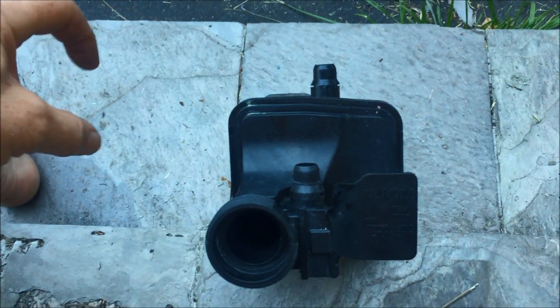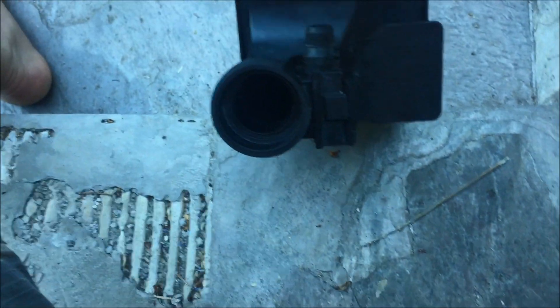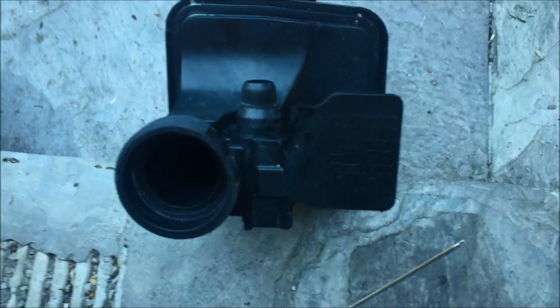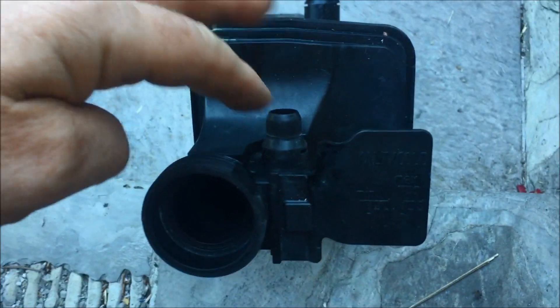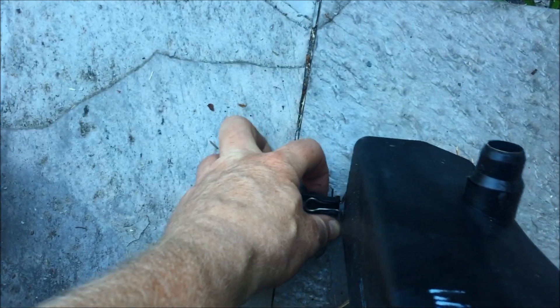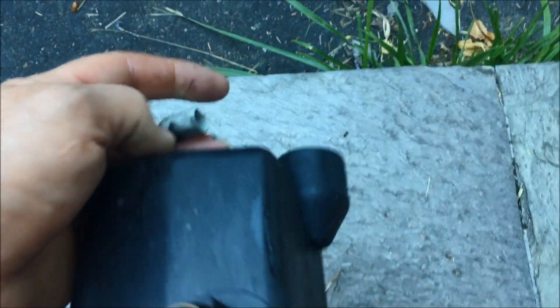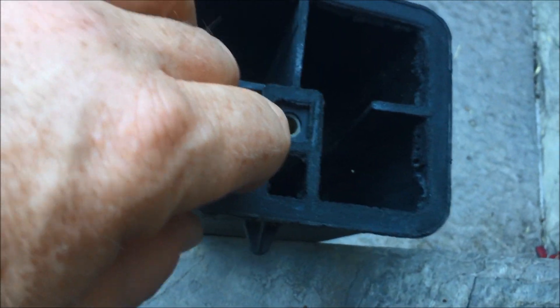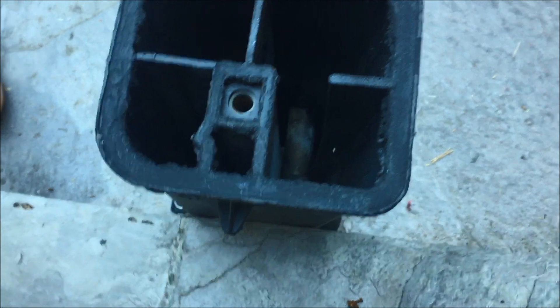Up top, there's also going to be a hose coming off the thermostat on the engine, connecting here and then connecting to the radiator hose. To remove this thing, all you have to do is remove this upper hose, reach down and pull this out, then reach underneath and press down the electrical connector and pull that out. There's nothing else to remove. When installing it, there's a little nub you have to be aware of that gets pushed into a little hole, which I'll show you in the video.